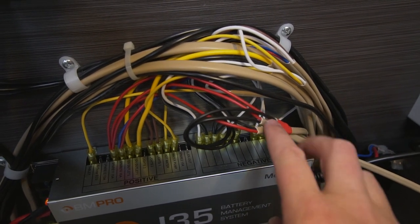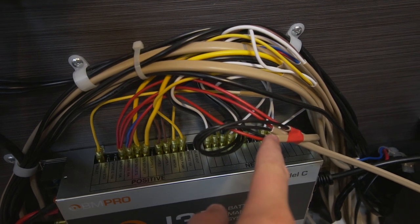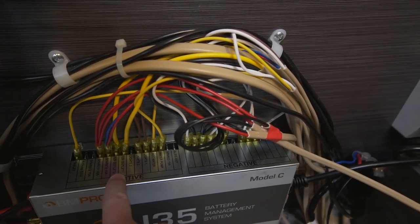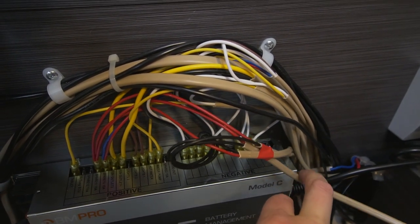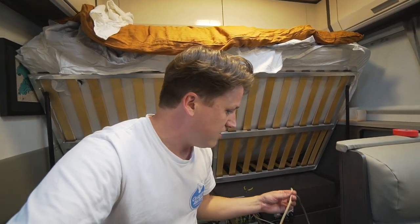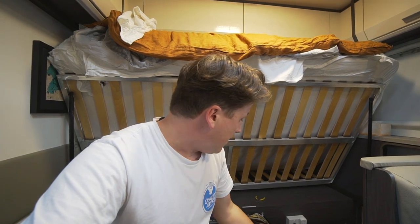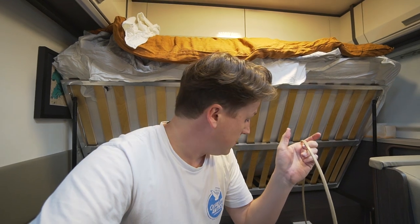We traced the cable all the way back and there are actually three power cables going into the same socket — it's labelled 'spare 10 amp socket.' One probably runs to the back bunks' cigarette-style sockets or up to the TV. All three positives go into one spade connector and all three negatives into another. I'm going to pull those out so I don't get buzzed while working on it. Since the cable is spliced in with the other two, I can't remove it completely — I'll figure out where to make my splice, mock it up with tape, and then solder the new bit of cable on.